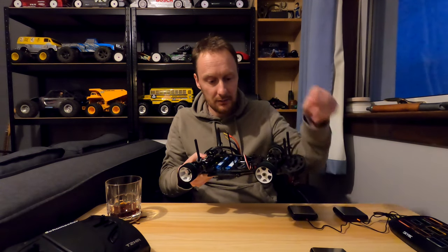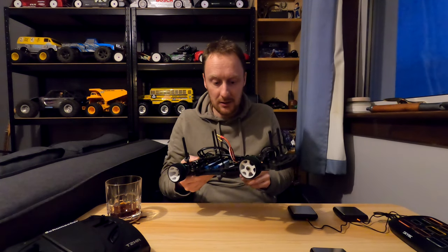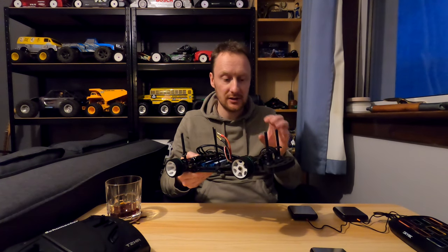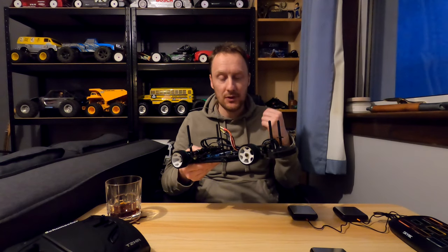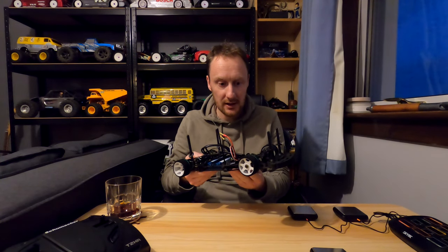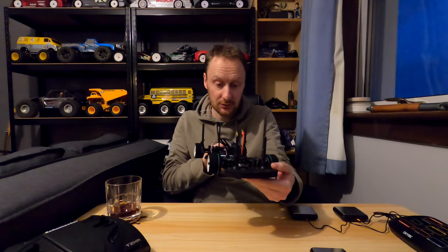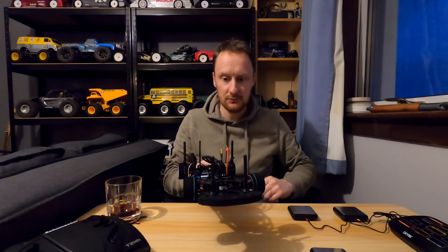The car is done. The receiver isn't stuck down yet and the wiring hasn't been done yet. The reason for that is there is a minimum weight limit in the BRCA — the British Radio Cars Association — in the UK. The UK rules for this class require a minimum weight of 950 grams. That's car, battery, body shell, the lot. I haven't weighed this thing yet and I don't know what the weight distribution is yet. I've got this new thing here, this SkyRC weigh station — it's a corner weight system.